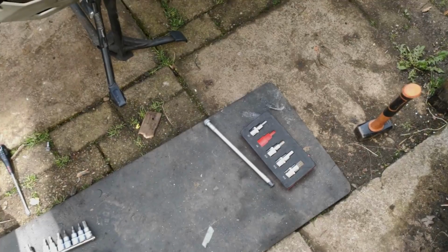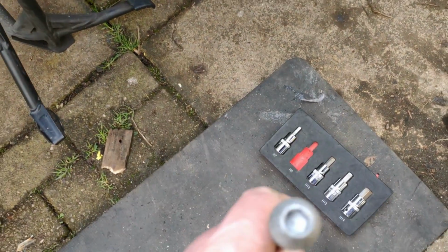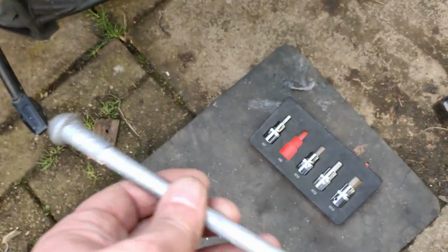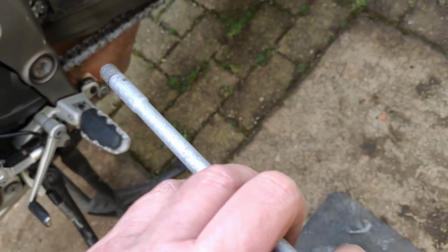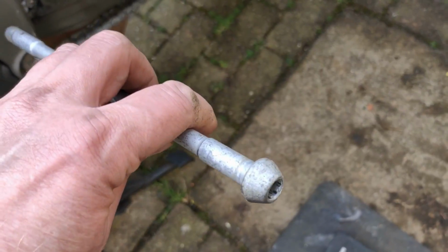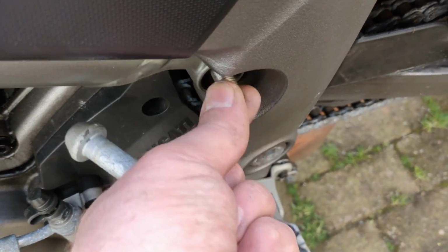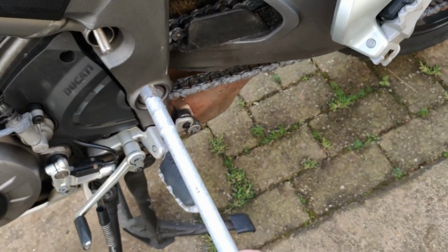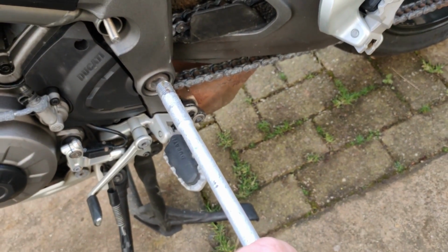So we've got the engine mount out, as you can see. There it is there. I think it's an M14 hex or multi-spline there with a captive nut on, well, not just a nut on the other side. It effectively goes through like so. What they advise you do is, that's the new engine mount bar there. As you can see, there's not a lot of tension on there, but they do suggest you tap out the original, as in this one, using that one so it doesn't stress the mount per se.